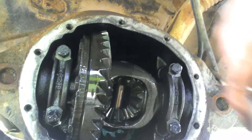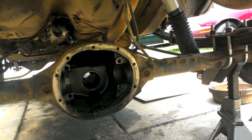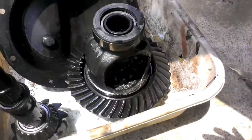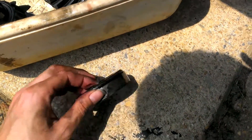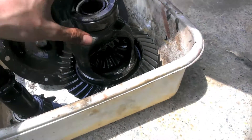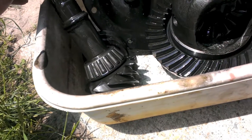If it doesn't fall out you'll need a pry bar to pull it out. I left the top bolts a little loose and still in there because my carrier was just ready to fall right out — so carefully palm it, hold it, and take it off. Make sure you remember how the bearing caps came off. Here's your carrier — you got your outer bearing races, and mine are shimmed on the outboard side. If these shims are different lengths, make sure you remember which side is which — don't mix those up.